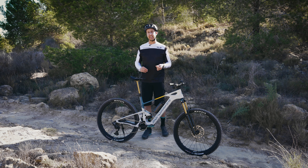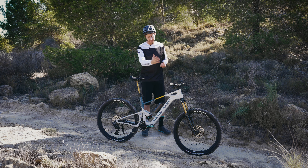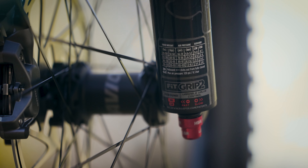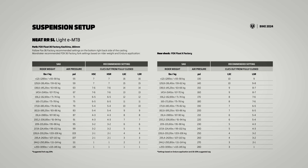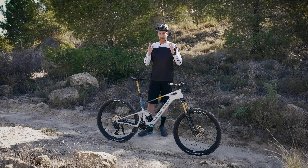There are two ways to translate that percentage into the amount of air pressure you need. The first way is literally looking at a chart. On the back of these forks, for example, there is a chart that correlates to your rider weight and gives you a guideline air pressure. Mondraker have one of these for every single bike in their range, and you'll find whatever manufacturer bike you're riding, you'll have the same thing on their website. You can put in your weight in pounds or kilograms, and it will make a recommendation to get to the required amount of sag. These charts will always be the best places to start.